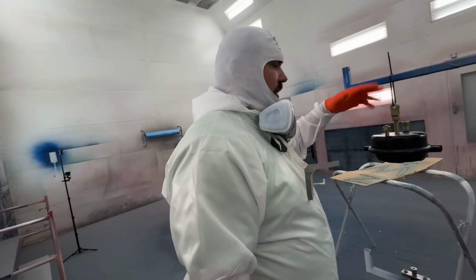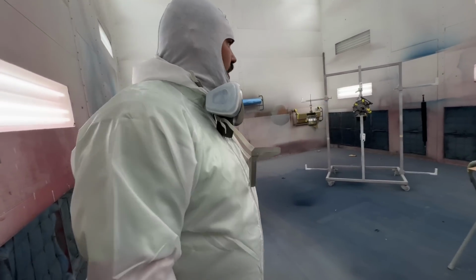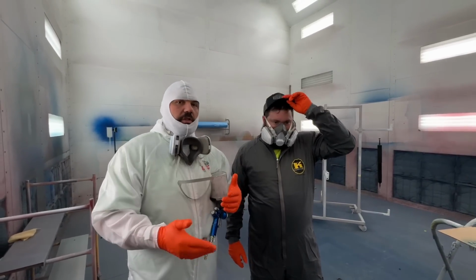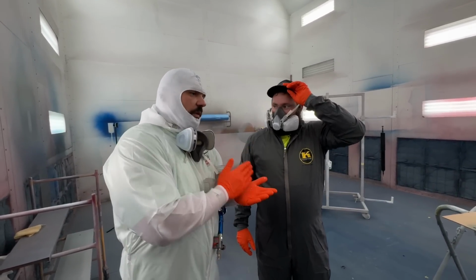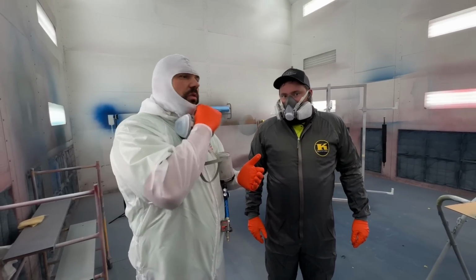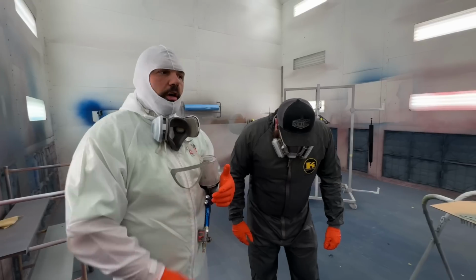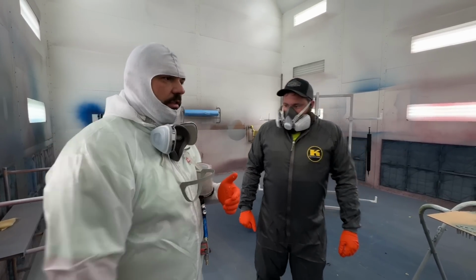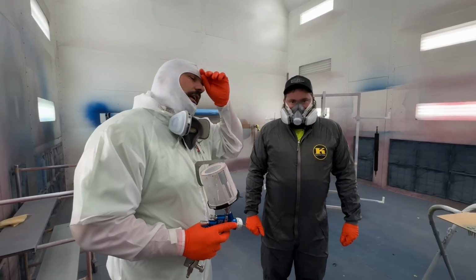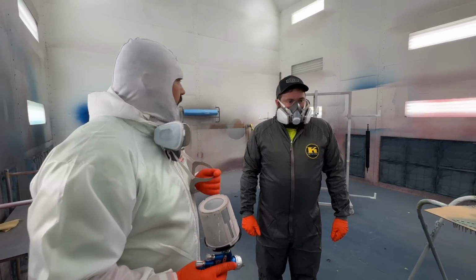We'll just come in here and dust some sealer on. It's hard to mess that up, so we'll dust some sealer on everything. This Imron is a wet on wet, so in other words, if you go from your base to your clear, you technically don't have to let it flash. I like to let mine flash a little bit. I clean my gun, take some water, come back in and clear everything. So this step we're going to do is a sealer, and we're going to just dust a good coat of sealer on, and then go from there.